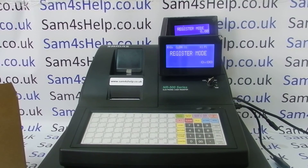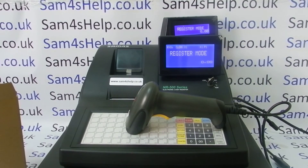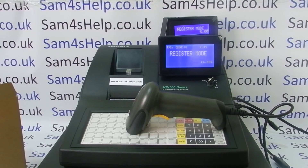If that doesn't happen for you, the next step should be to program your barcode scanner. The way you do that is — if you've got the till and the scanner from the same place — those people should send you a configuration sheet for programming the scanner, which will basically look like a series of barcodes and you have to scan them in sequence. That then effectively configures and programs the scanner to work with the port on your cash register. It's a really boring thing to do — you just scan a list of barcodes — but without those barcodes you can't get the scanner to work.